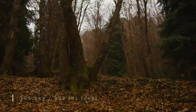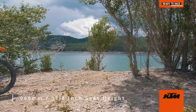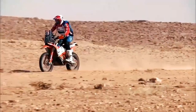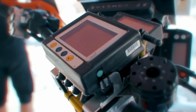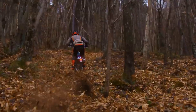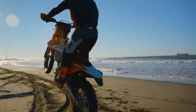If you want a big-bore thumper that'll do wheelies for days, this is the motor for you. But if you're a shorter rider, you might need a stepladder — the seat height is 960 millimeters, making it a very long-legged motorcycle. The downside with the KTM is shorter service intervals: the manual states oil changes at 15 hours rather than the 30 hours of the Honda or Beta. That said, plenty of people have shown you can service it on roughly the same schedule as the others, and there are aftermarket engine cases that allow the KTM to hold more oil, which is a real benefit.